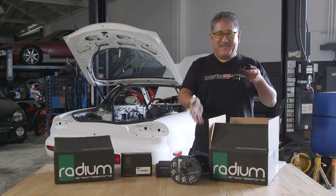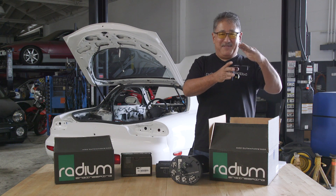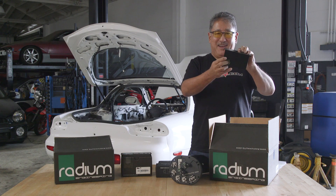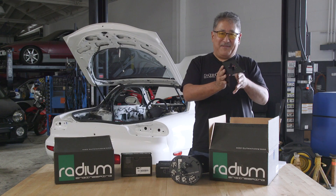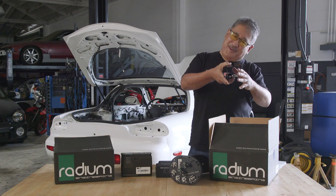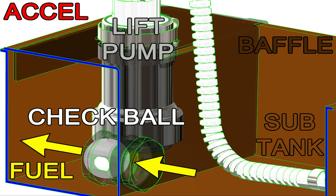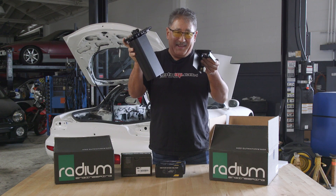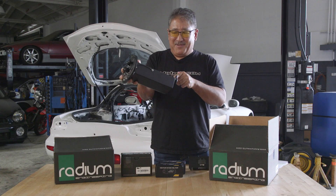A lift pump is a low pressure pump that feeds the surge tank. It's basically the same pump that feeds the high pressure side, but since it's not dead-headed it can move a lot of volume of fuel. The pump sits here in this bracket which also works as a baffle. There's a one-way check valve — this ball moves back and forth and prevents fuel from coming out of this baffled area, assuring that fuel is always around the pickup of the lift pump. During acceleration the check valve opens allowing fuel into the baffled area; during deceleration it closes so it doesn't allow any fuel to escape.